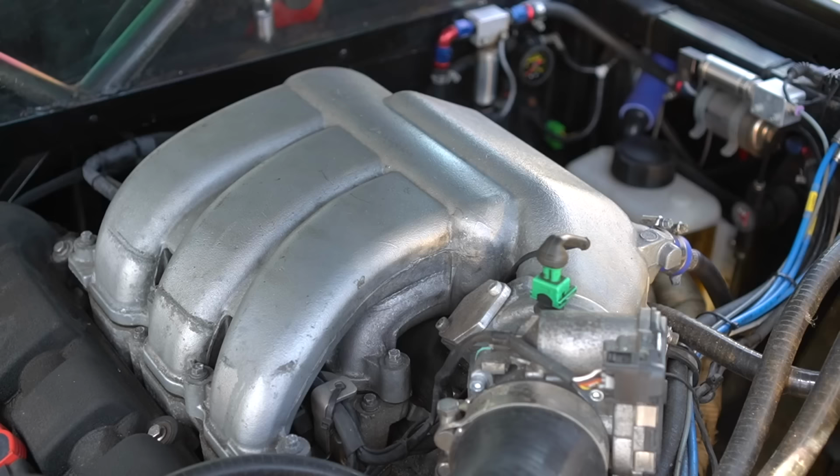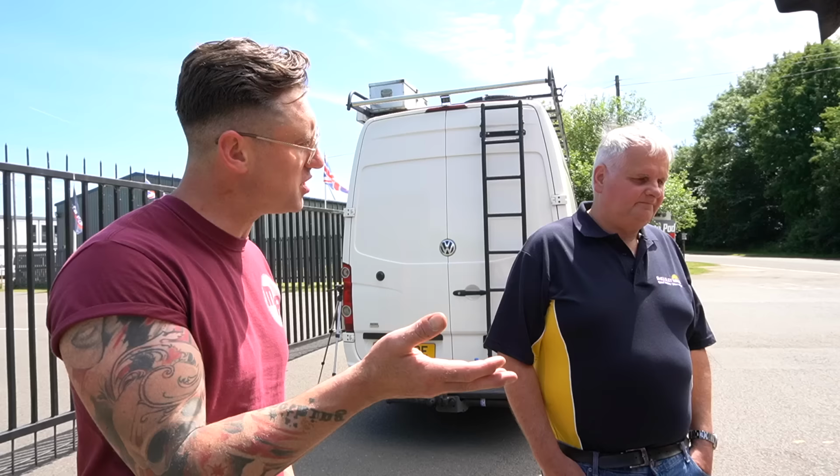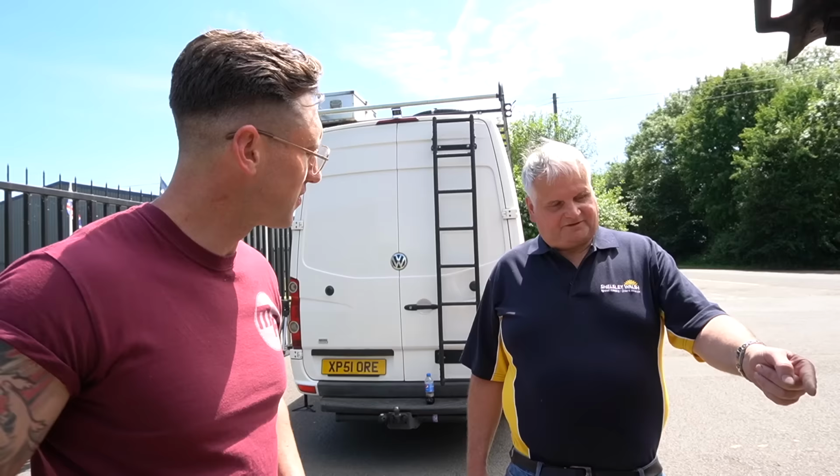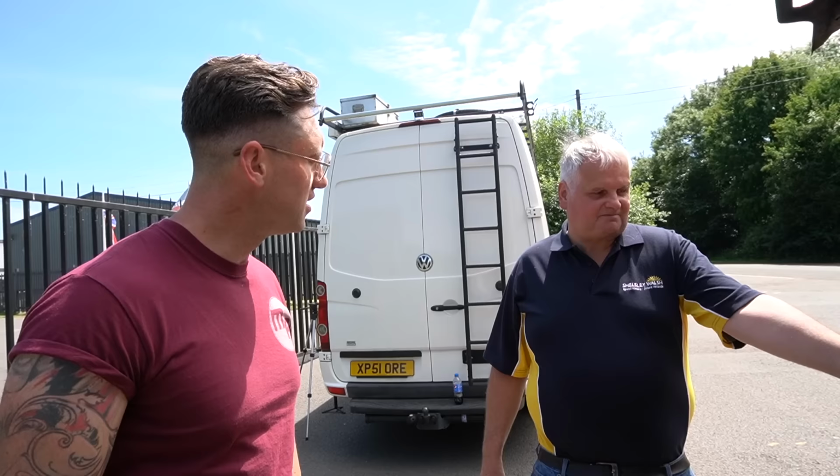I can imagine. Yeah. An interesting thing that Ian mentioned was that it's got water meth injection there. Yes. There was something a bit different about that, you said. Well, I've got two jets on this. Some people frown at it, but I've got a very small jet aiming into the mouth of the turbo, and what that does is actually shift the map over a little bit, so you can push a turbo just that little bit. You can't keep going because it's blowing up. Yeah. But you can shift it over, and then the main water meth is standard position, just prior to the throttle body. Yeah. So it's actually got one fine spray. Yeah. And a proper jet.